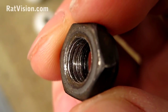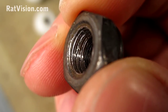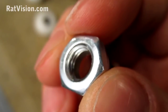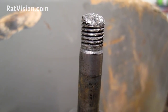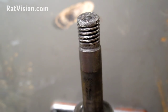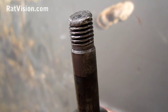Let's take a close look at this axle nut. You can really see how the threads have been flattened and jagged, and you can also see how chunky it got. The damage was caused by the threads on the axle as I unscrewed the nut to replace my wheel. Check out this new nut — you can really make out the deep grooves and sharp threads. Here is a close-up of the axle. Notice how the top looks like it's spilling over a couple threads — it has filled in the groove so the threads from the nut can't go on. That's probably where the original nut got flattened out.